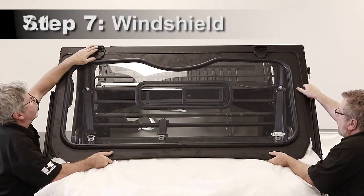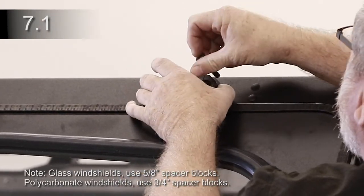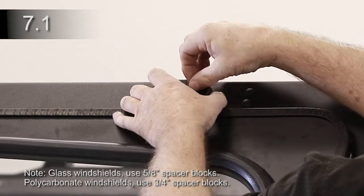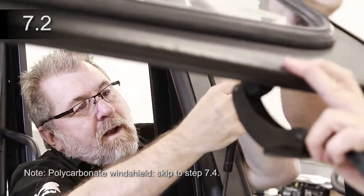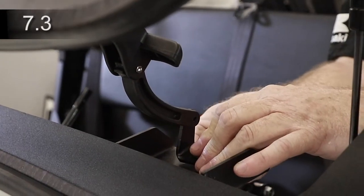Place a hinge spacer block into the windshield hinge and two flat 5/16 bolts through each hinge. Place the windshield into the windshield support with the bolts through the slots and secure with nuts. Install the shorter gas springs into the windshield frame with the piston rod downwards. Install the latches into the windshield frame.